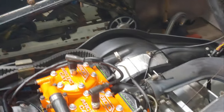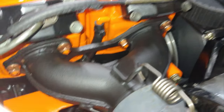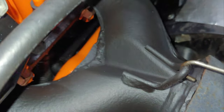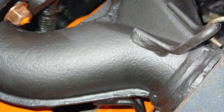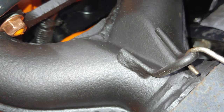And then another major thing, if I can get my hood all the way open here, was the engine was super oily on this front side. And that was because when I initially got this, the Y pipe had a crack in it right across there. Well, another one formed on this side, and then I didn't realize it, but there was another one on the bottom right across here on the bottom side. And it wasn't in the main pipe section. It was just pretty much in that real thin metal there.